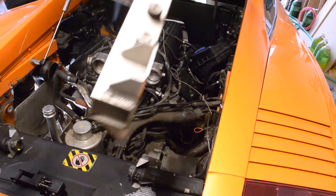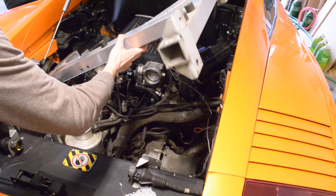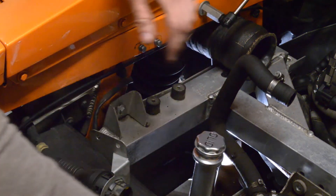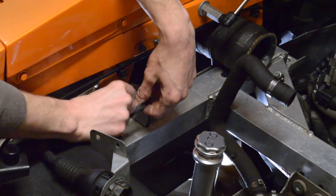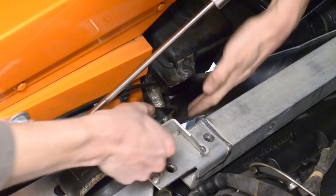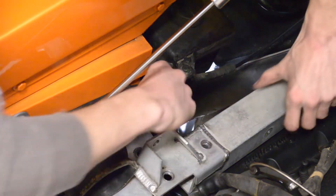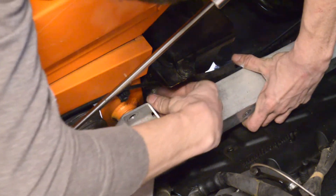While I was still waiting for the test pipes, I decided to put the subframe assembly back in since I had so much space. I'm going to do this by installing a bolt on both sides in the back, and then these little subframe shims just slide right in behind there. Same for the other side. The fronts are a little bit tricky — I recommend getting the bottom one first, getting it properly seated, and then holding on to it while you position the top beam in place.